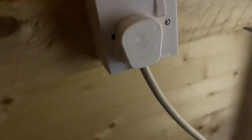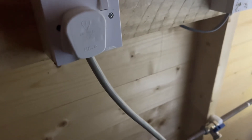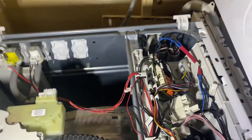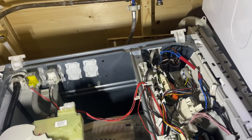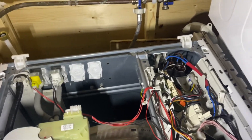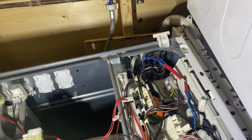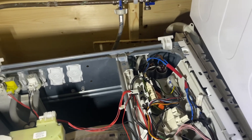You do also have to change the plug, because it has that big commercial plug on it — a big massive thing. I managed to buy this cable and set — you can buy the back part off eBay, sometimes they pop up. I bought a whole new back part for it, and it came with the mains cable and the capacitors too. On the lower wattage it doesn't need the two capacitors — I think they're there because of the five kilowatt setting. But that's not something you need to touch, and it's probably better you don't.